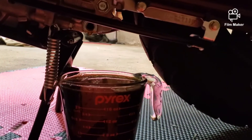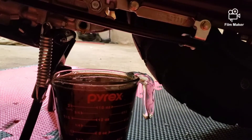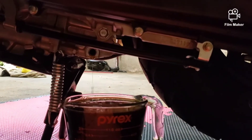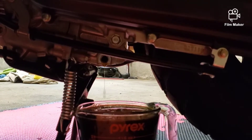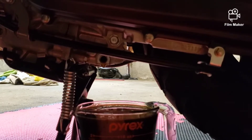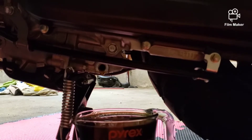So it wasn't too overfilled — it was right at just a little over 600 milliliters. I did this off camera, but you can actually take the bike and tilt it to the side to get the last little bit of oil out. Now that we've got that done, I'm going to reinstall the drain plug and then we'll move on to the screen.